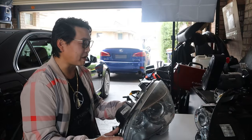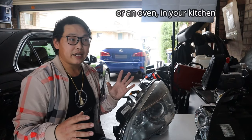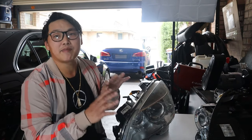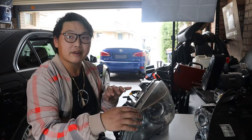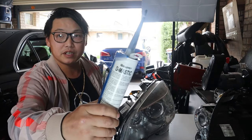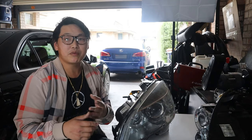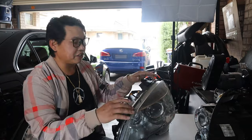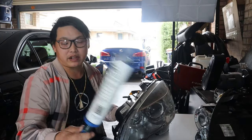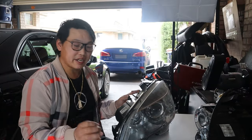Once you get to this part you're going to need either a hair dryer or a heat gun — I've done it with both and they both work fine. You need to use a box or cupboard that can house the headlamp and heat it up enough to pry it apart from the sealant. The sealant they use is D-mastic — it's a type of sealant that can seal different materials like concrete, wood, and plastic to create an airtight seal. You can get it in a caulking gun or in a strip. Either way you'll need it to reseal the headlamp afterward.